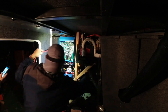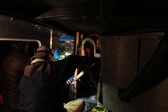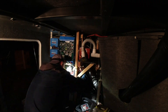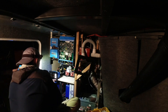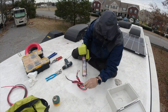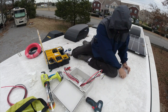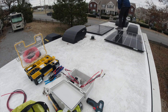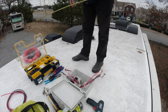Once I got all that reconfigured and put back together - by the way, this was one of the most comfortable large bays I've been in, with all kinds of room. I was actually up on my knees and still had room above my head. The second MPPT showed up a little bit later in the install, so I'm getting it connected, wired, and put in place - getting the combiner box all connected. His roof was so clean with very few things on it, I could have gotten eight 300-watt panels up on the roof.